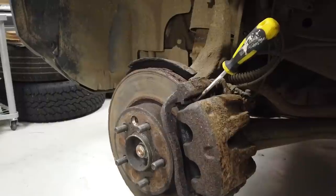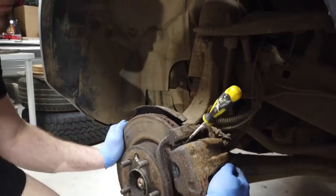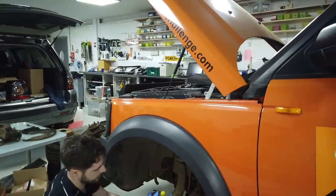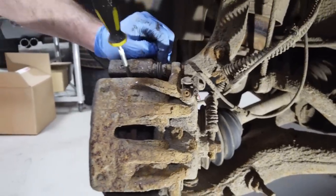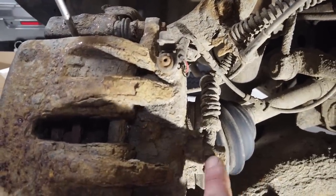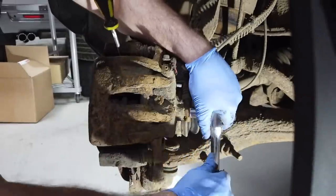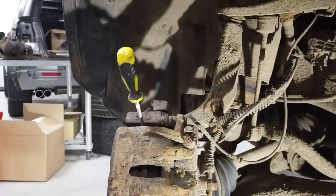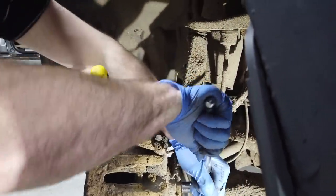Before we get too excited, let's have a look at taking the hydraulic hose off. We are going to undo the hydraulic hose - you can see how caked up and rubbish this is. That's a 14-millimetre socket on that one Gary. We'll whip this off - careful, there's two copper washers, one each side of this banjo fitting. Just make sure we collect those and have a bottle handy to collect the dripping fluid. I've drained the other side already so I won't have too much.